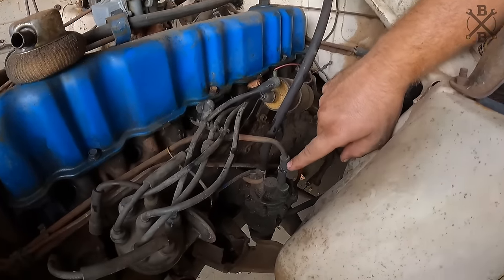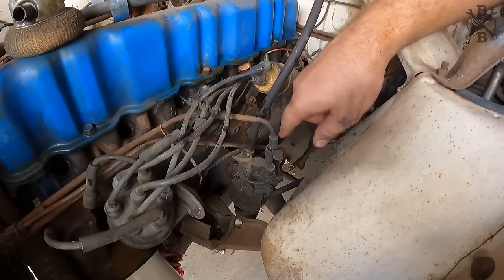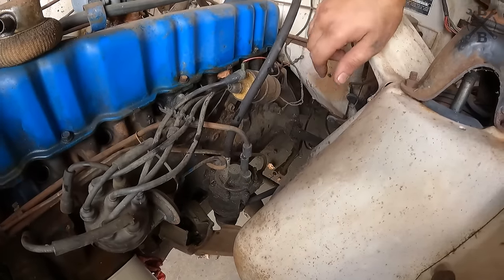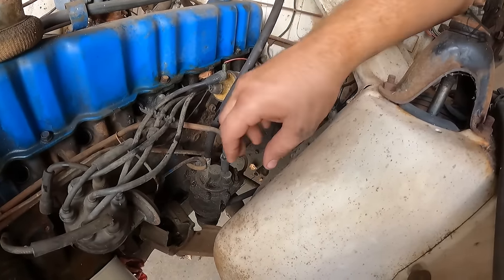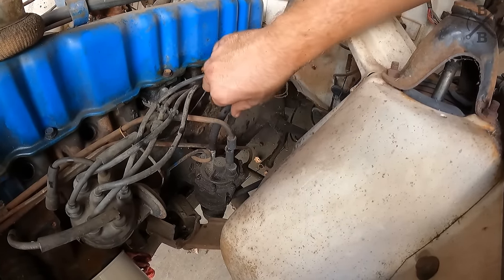We'll also notice with this fuel pump, this is actually the original one that came off the 144 because it has the vacuum side to it. By 66, it would have been like the Mustang, just a normal one-phase fuel pump instead of this dual supply deal here.